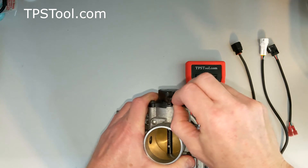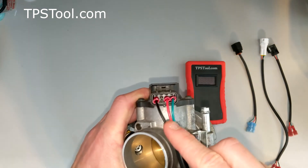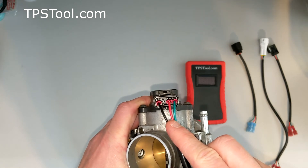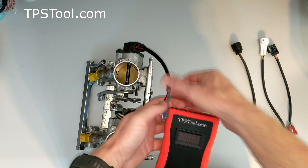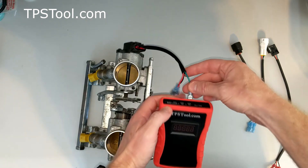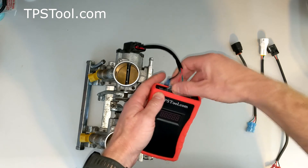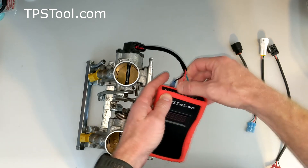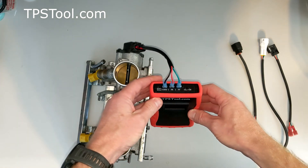The far left one is the ground black — so that's how we've wired it. We're using those three pins and skipping that one. On the meter itself, we're going to put the green into 5 volts — that's the 5 volt supply — red goes into FB feedback, and black goes into ground. That's how we've got it wired in the meter itself.